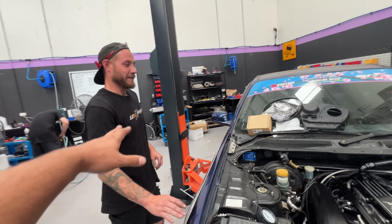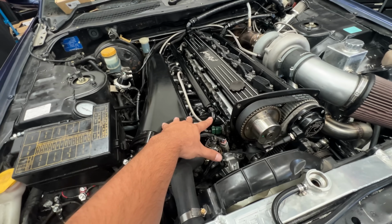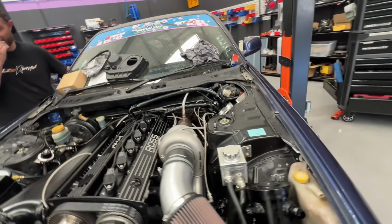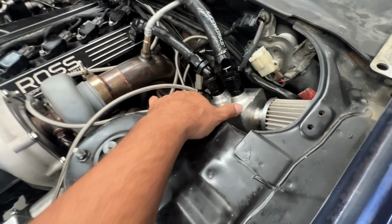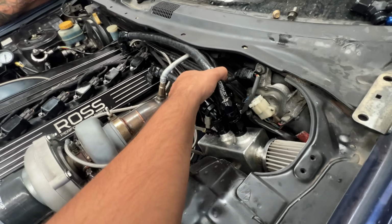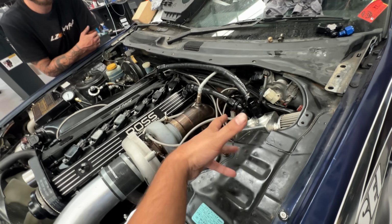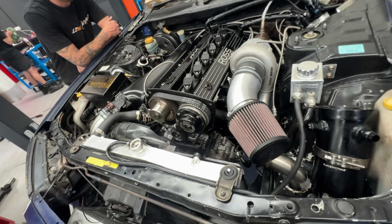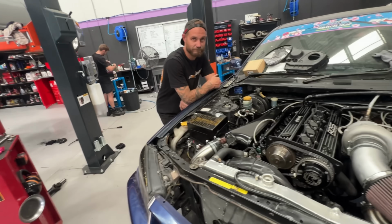You've had a few issues now with this thing. You've been going back and forth with our oil pressure issues. Then we had a little leakers here. What else do we have? We're getting there. We got a catch can too, which is an interesting location, but it's going to do the job, and we're going to have it drain back to the sump. So it's really just somewhere for the heads to pump into and hopefully breathe a little bit. We still do have a standard sump on this, which we were hoping to change, but we're on a time crunch here, so we'll just bang an oil cooler on it and send it.